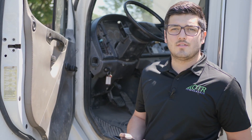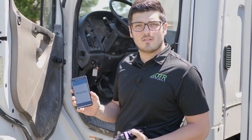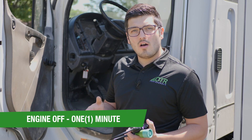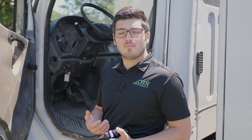To do this procedure you need a timer — I have my phone here with the timer ready to go. Make sure the engine has been off for at least one minute before starting. The truck's already been off for a minute. We're going to start the truck and let it idle. Cruise control has to be in the off position and the parking brake applied.